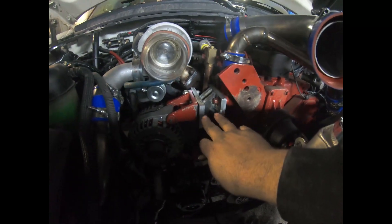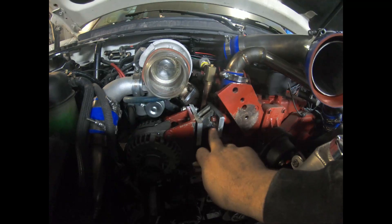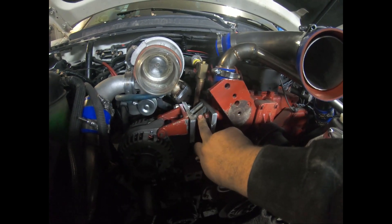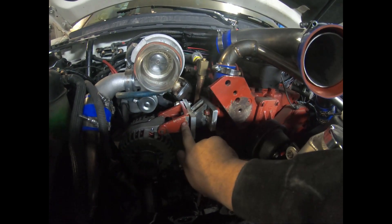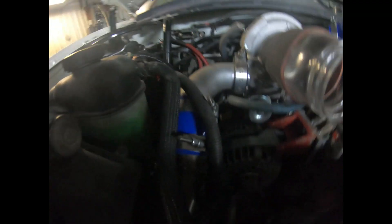Alright, we got our first edition of the bracket made. The alternator had to go down and back, so we accomplished that — I machined a plate, made these two gussets, then machined another plate and drilled the holes through, and it is mounted back down in there. The only problem is it's too far back — it has to come out about the length of the pulley. You can see the laser on the end of the pulley coming up from the AC compressor — it's at the very back of the compressor pulley and just catches the front of the alternator pulley.